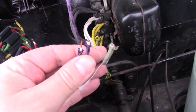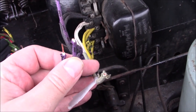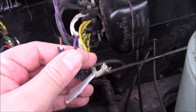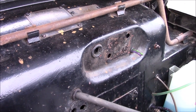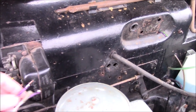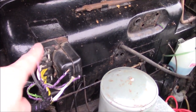What's slightly confusing is one of these is for the wiper and one is for the horn, and I don't know which is which yet, so I'll have to do a continuity test and figure that out. Luckily the wiring for the wipers just pops out there, so I don't have a lot of distance to bridge. Once I know which one is which I can get this all connected up.